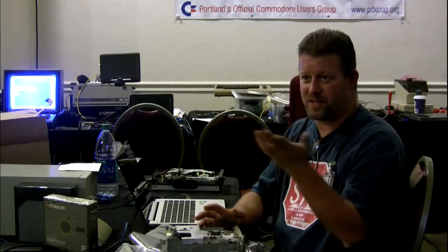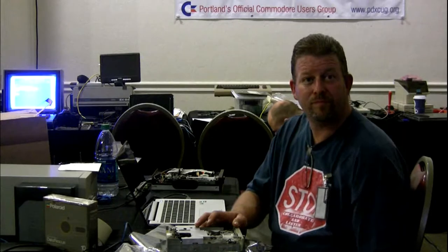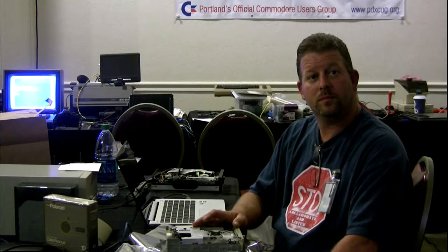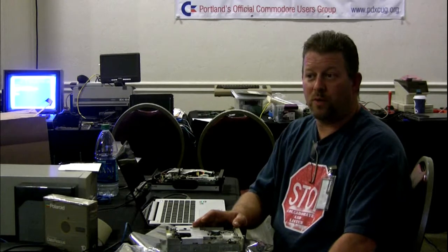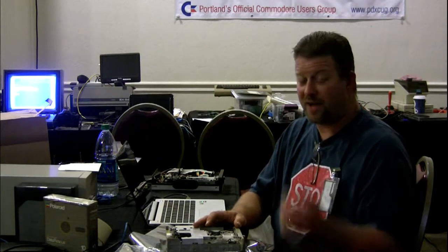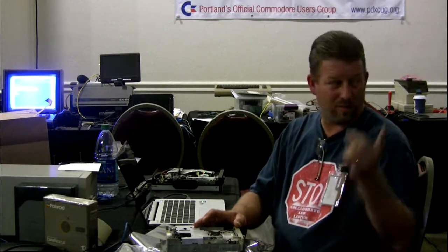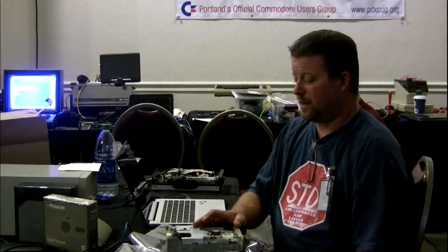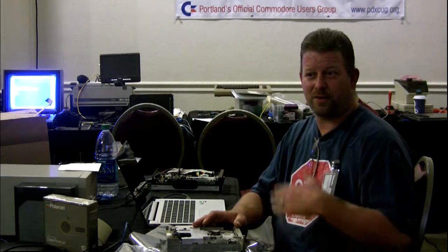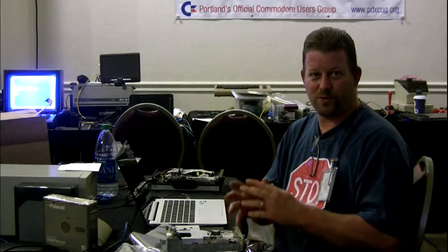Discs compatible with the C16 and the Plus/4 will work as well. As for other formats like Apple and Atari — it may or may not work; I've never had a chance to test those since I don't have any. If somebody wants to test some and let me know, that's great. You'll probably have to use a different solution. The CryoFlux will only allow you to read those formats — it won't turn them into an emulated file and won't let you write it, so those are for preservation only.